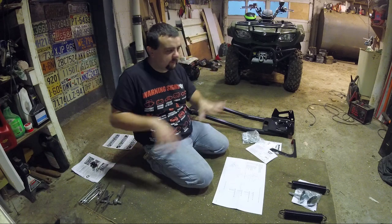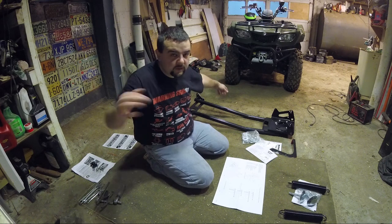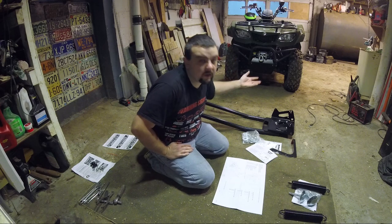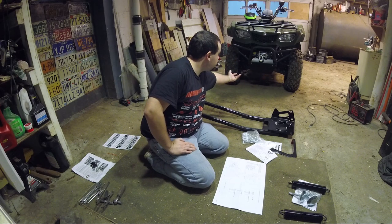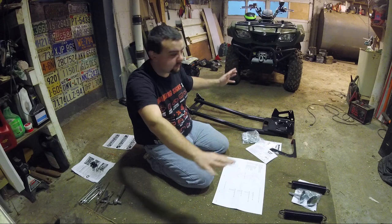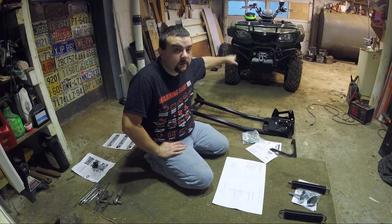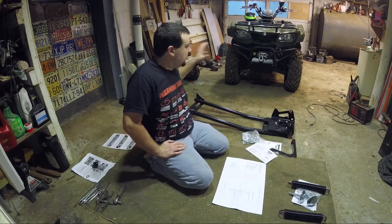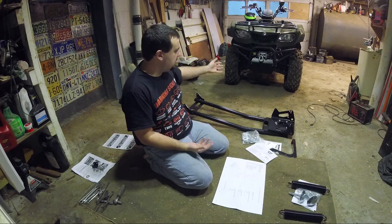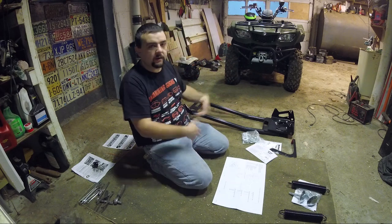So everything comes in their own separate box. You purchase all the stuff separately, like the bottom piece, and you'll see this stuff in the description of the video. The actual frame mount, it's called the center mount in this case. That's its own box because this piece and the plow itself are generic to all the ATVs. And the actual mount itself for the Suzuki is specific for the Suzuki. So this stuff is the same for all the ATVs you want, but all you really need to do is change the center mount, and you can put this same plow on many different things.